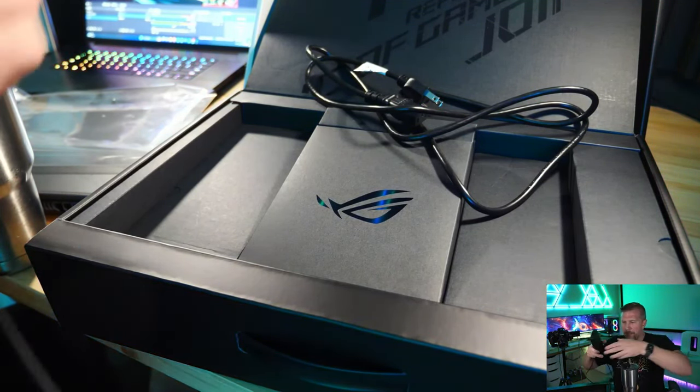But we're going to jump back into manual fan mode again, which is going to max out our fans, do a slight overclock on the GPU as well. All right, so notice our TDPs both jumped up like 20 on both the CPU and the GPU pretty much. It was like 55, 60. Now we're up to 80 watts, and we were doing like 35, 40. Now we're doing 56, 60 watts on the CPU. All right, and our temperatures also can go a little higher now because we're raising the power limits above.